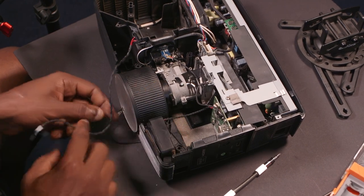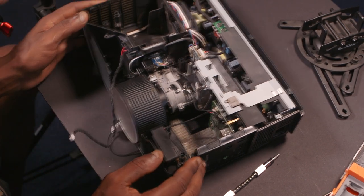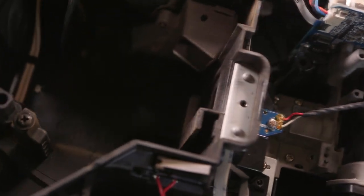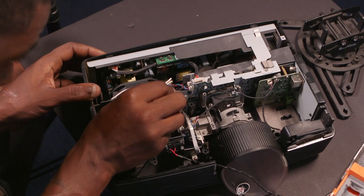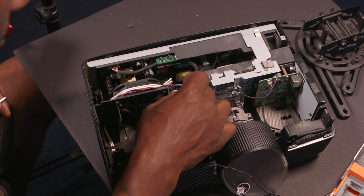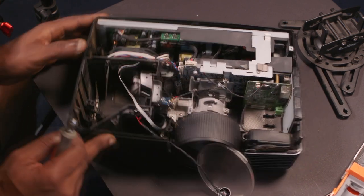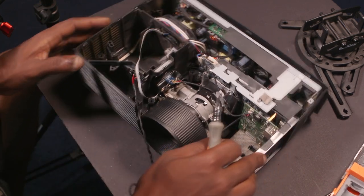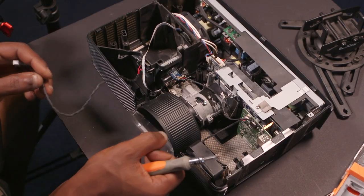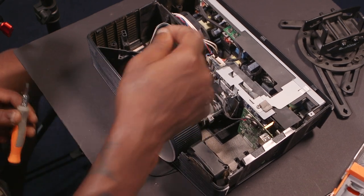There's a wire going up over the color wheel housing — don't want that in the way. There's a little lip right here too, and another ribbon cable holder. Remember, fixing PS2s — those things break easily. The plastic on those corrodes super easily; you barely move the little hinge and it's already broke.